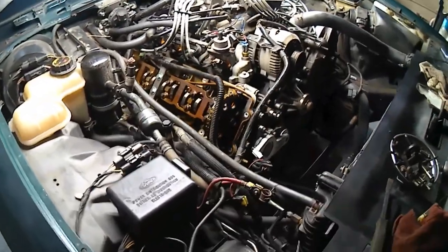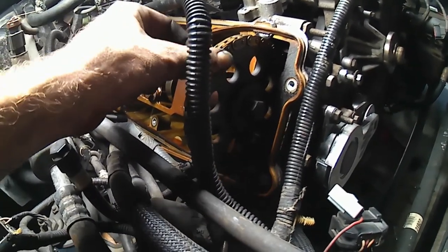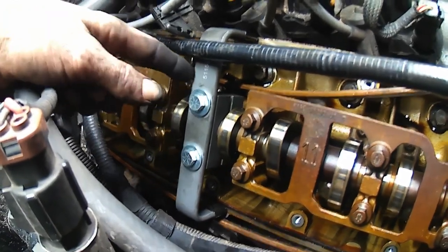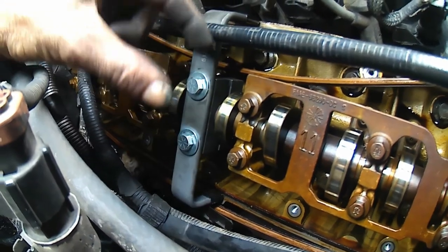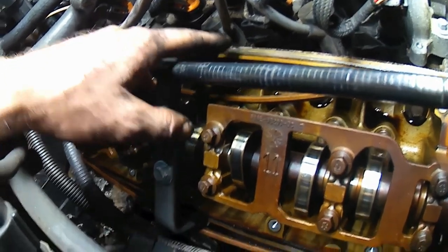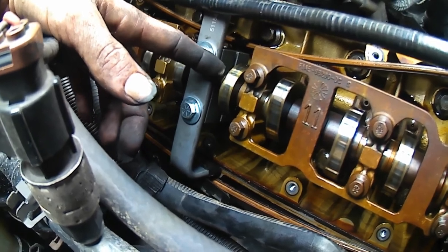Now that we got that valve cover off, see, there's our left passenger side cam gear and our chain. Now I come over here with our fancy expensive cam holding tool. On the bright side, it was expensive, but at least it fits just right. Both the little legs are sitting flat on the mating surface for the valve cover on each side here, and these bolts are tightened down good and tight to keep a cinch on that cam so she won't spin on us.